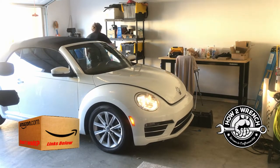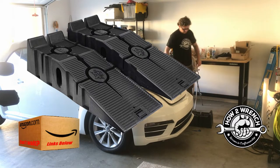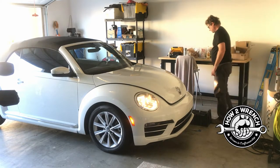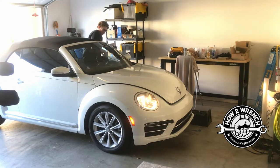First off, you can see it's just simply one of these car ramps and we just used one of them to tip the vehicle so that the motor is dumping all that oil towards where the dipstick is — where we're going to insert the pump tool so that we can actually extract all of it. Pretty simple, but super effective.